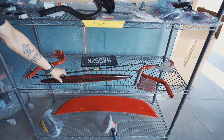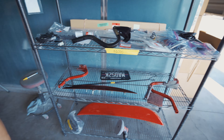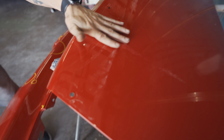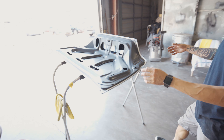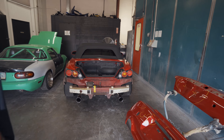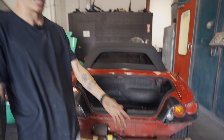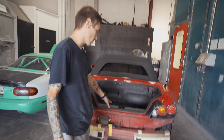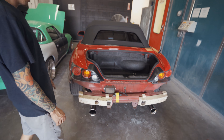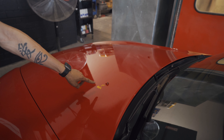There's also GT350 stuff over there — old parts here, new ones in the box. One thing we do have to do: this deck lid has holes drilled for what I believe is an OEM wing, so we have to drill the holes into the new deck lid after it's prepped, then fit it and make sure the body isn't smashed in. The concern is it got hit really bad right here, so we're worried it may not latch properly — we're going to make sure the new OEM deck lid latches and fits correctly.